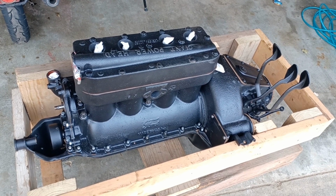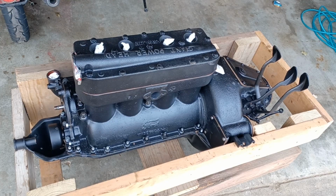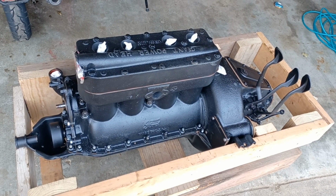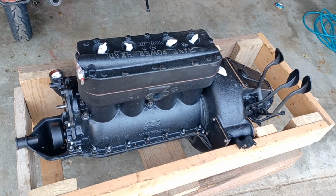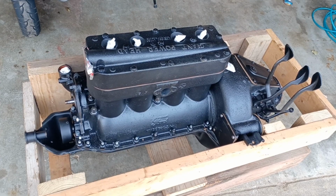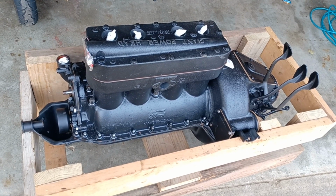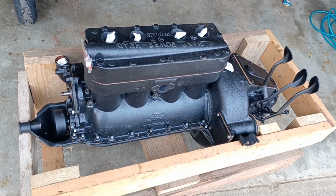So it has new Babbitt, ground crank, reconditioned rods, a new 280 Stipe cam, reconditioned field coil magnets, a couple new transmission drums, new pistons that I showed before, 40 over. The block, the hogshead, and the head are mine. He had to swap out the pan because mine was bent on both sides. But it's pretty close to being ready to go. I need to get a carburetor and some manifolds and a timer. I already have some coils ready to go.